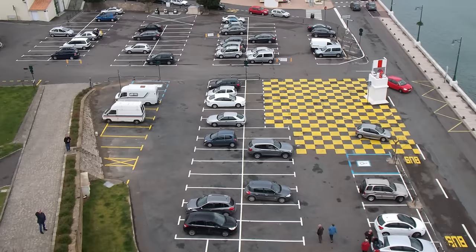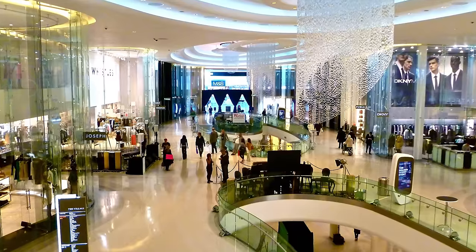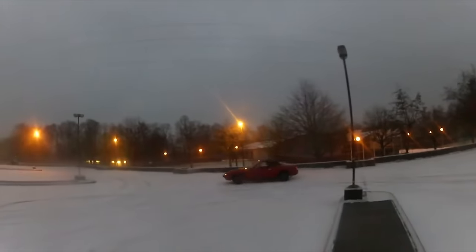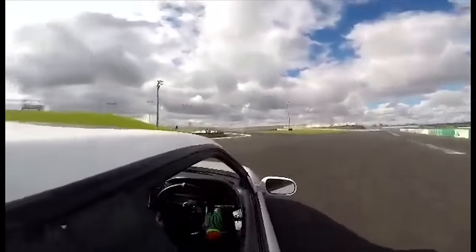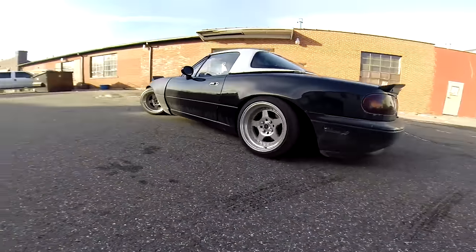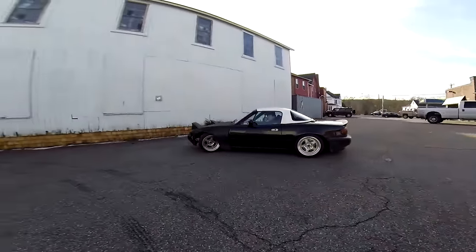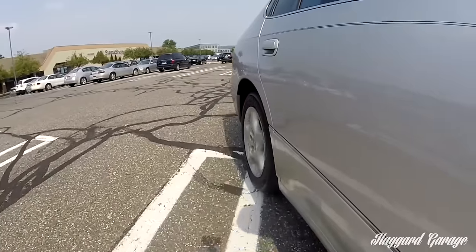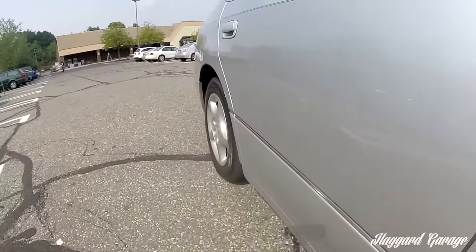Car parks are your worst enemy. If you didn't already like navigating through tight and crowded car parking lots, your day is going to get a lot worse with a welded differential. While high speeds and shallow bends mean you won't even notice the effects of the welded diff, in slow tight corners you'll be in a whole world of pain — especially during tight parking manoeuvres. It's here where the welded diff bites you in the ass with hops, skips, and the sound of screaming drivetrain components. The effects will be doubled when reversing out of a parking space.